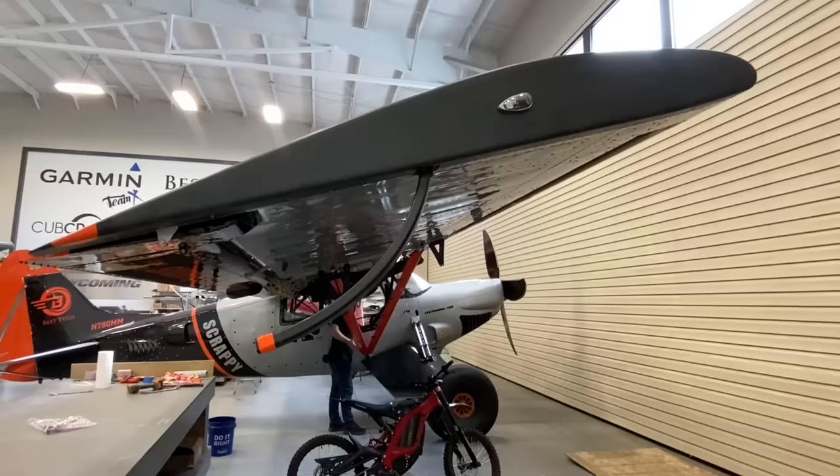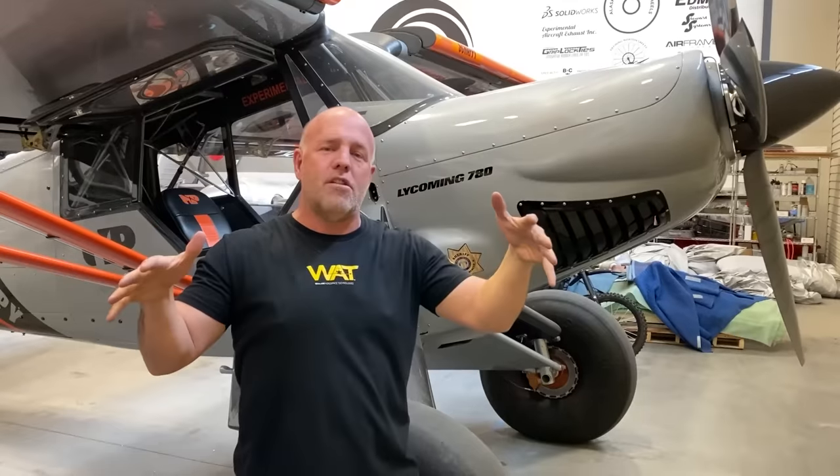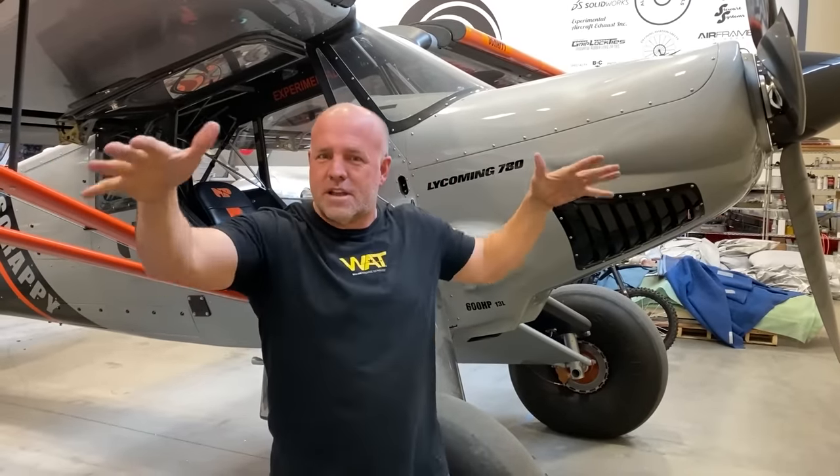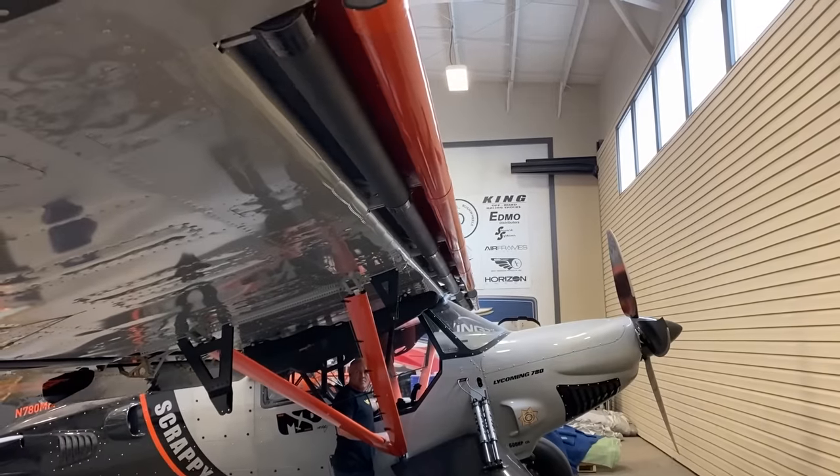One of the first things I had to pay attention to was I had set my wing to try and neutralize pitching moment as the flaps and ailerons droop, with the front going out. I sized the growth of the front of the wing to counteract the pitching moment of the back. A lot of aircraft, when you drop out flaps — especially big ones — essentially this plane's entire length of wing, because the ailerons droop, would create such a massive pitching moment. I countered it with the double leading edge at the front of the wing. I always wanted a little bit of back pressure as I added flap — just a tiny bit — because I prefer landing with a little pressure pulling towards me. Adding this took me from absolutely no trim change to just a touch of trim or maybe five pounds more aft pressure. So I'm really happy with that. I just feel a little bit of pressure on my hand when I deploy full flap, full drooping aileron, and full front.